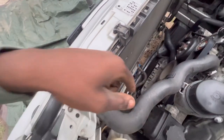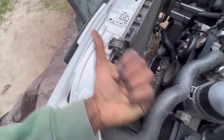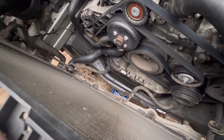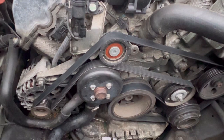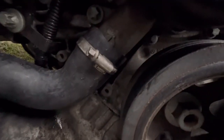As you can see, it's kind of bent. My brother had changed the hose the other day — he thought it was just a cut, so I had him change it. He did a good job, but we're still having a leak after we pushed it hard. Earlier it was all the way towards the top, now she's about dripping out. So the only thing we could come up with is the water pump. It's the obvious thing — this car is getting wear and tear on it. You can see a drip. Got to be coming from the water pump on the back side.